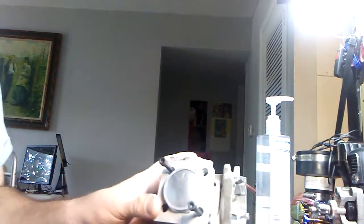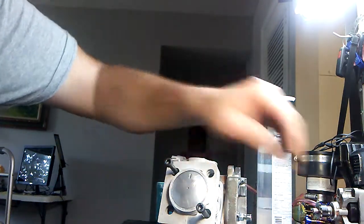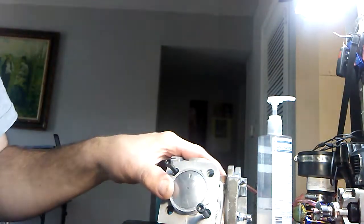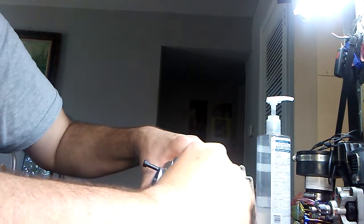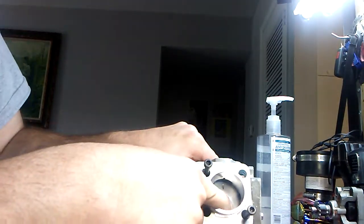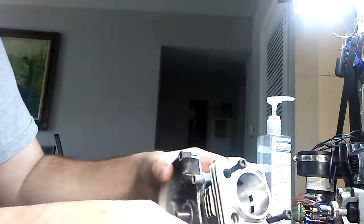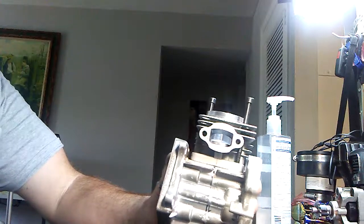So, you got the piston in there. She's out of the bore. I've been shaving this down here. It'll actually make good compression this way. So when she rotates on this motor, my exhaust is up here. She comes on down and she stops right there. So, you can see the transfer ports where she gets her fuel from, and then up there is the exhaust. Well, the only problem with that is, you see where the piston is? It's still in the port.